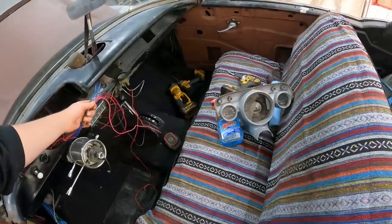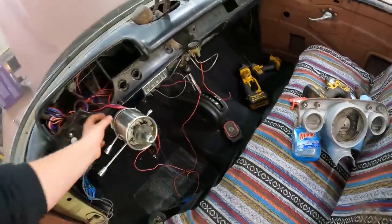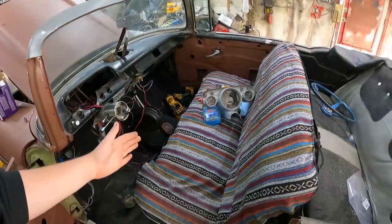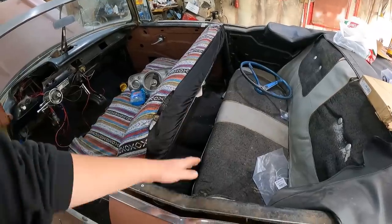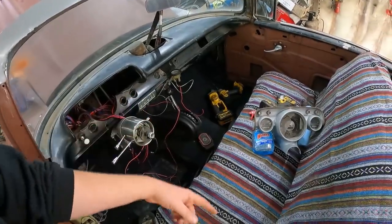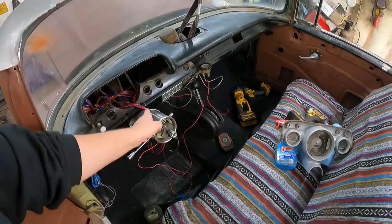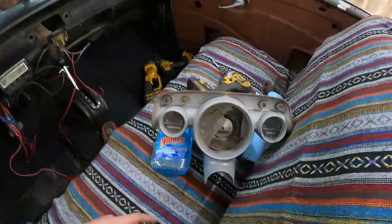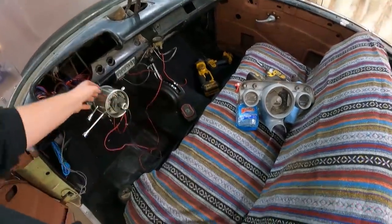The only issue I'm going to run into now is the way a '57 goes, it has this big trim piece just to cover the column, but because now I have a tilt column and I sucked the column in a fair bit. Now here's my thinking. I wanted a seat in the factory location, so there was some room in the back seat. I typically push it back, but every inch you push back, you lose in the back. This way, with the tilt, I can have it all the way back and fit a smaller wheel. I have the factory wheel, a smaller wheel fits, and I can drive it by pushing the column further away from myself. That in turn is now going to screw that up. I didn't think that all the way through. So I will have to trim this, which I'm not really caring too much about, but that's what we're going to work on now.